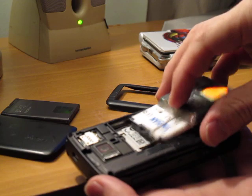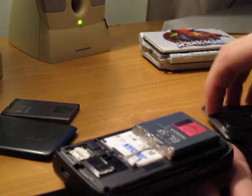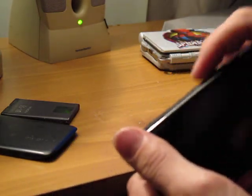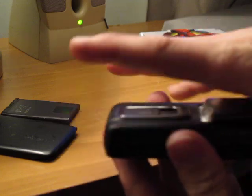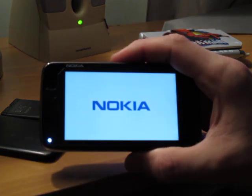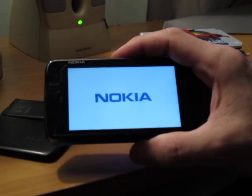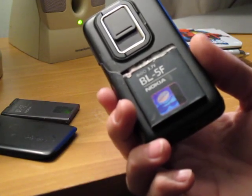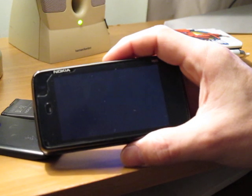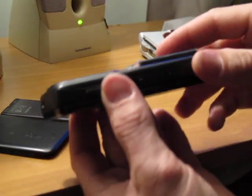They run all the way to the front — the center one is the negative, the side one is the positive. As you can see, everything hooks up and pretty much fits like stock right on the phone itself. The battery cover does not give me any problem once I cut it up. I'll probably do a vinyl cover and it should work fine. With the 1320 milliamp stock battery plus the 850 milliamp BL5F battery from the Nokia N95, it gives me pretty much the same amount of battery as a Mugen battery.